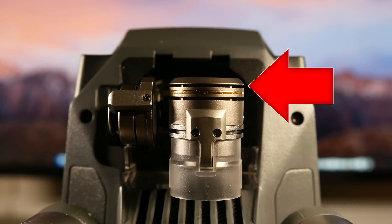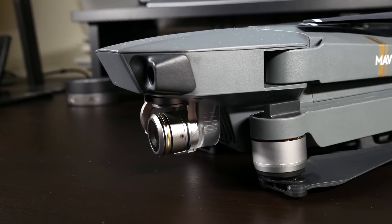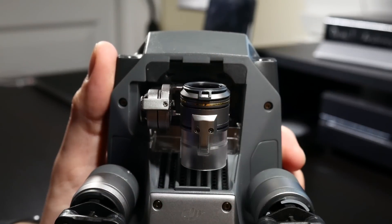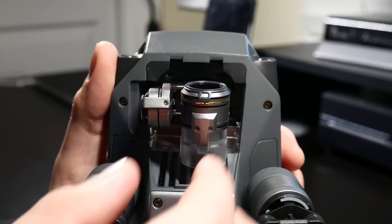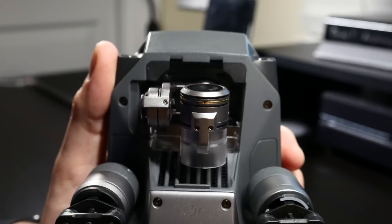As far as the installation process goes, it is super simple, but should be done in a specific way to make sure no damage to the gimbal occurs. First, ensure that the gimbal clamp is put into place to alleviate any unwanted fidgeting. Next, lay the drone on its butt — the side that has the outtake vent and LED on the back. With the camera pointed to the sky, simply lay the filter into place, then gently apply pressure around the edges until it pops into place. To take off the filter, simply push up on one of the tabs to unlodge it. Be careful as it could go flying, and a little piece like this is easy to get lost.